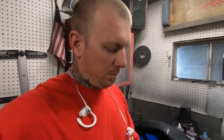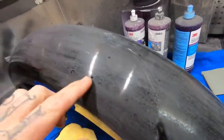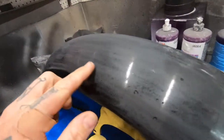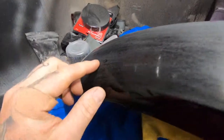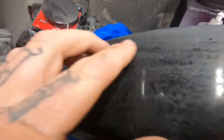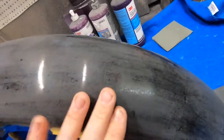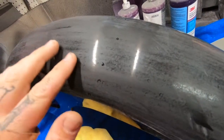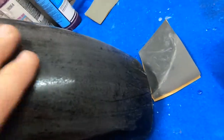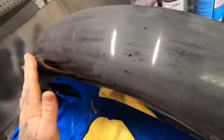After doing a little bit of wet sanding with 1000 grit, here's what it's looking like. You can see there are still high spots, some orange peel, and right here there are particles that got into the clear coat. I have enough clear coat on here that I can sand all that down. I'm just gonna keep going and I'll show you guys the progress as I continue.